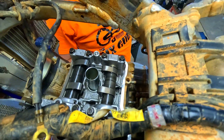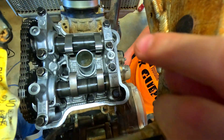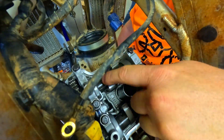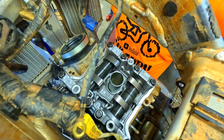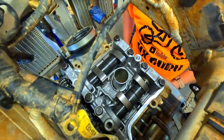We went two sizes on all four of them and they all worked out. If we really wanted to we could take this back off and probably squeeze one more shim size out of this one, but we don't need to — it's within spec, so we're good to go. Make sure it's in time, put it back together.